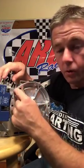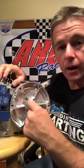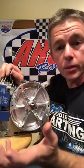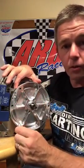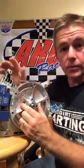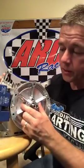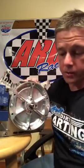You're looking at the coil and you're seeing the magnets when the coil fires, where the magnets are in relation to the coil. And like I say, with the OEM style coils, you're going to see the leading edge of the magnet, right hand edge of the coil. The PVL ignition, you're going to see the trailing edge of the second magnet. You can't even see the magnets there, they're still underneath it. The trailing edge of the second magnet with the right hand edge of the coil leg as it rotates. That's the point of shining the light at the coil, is to see where it fires.